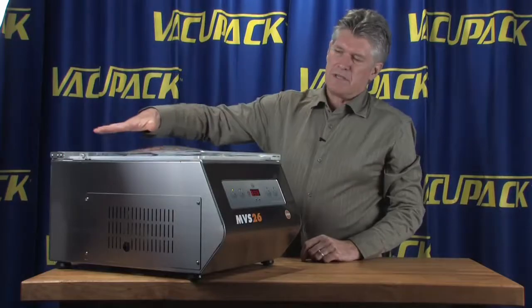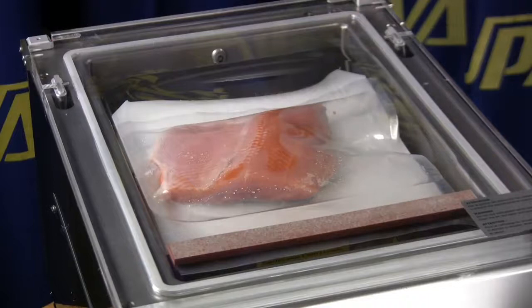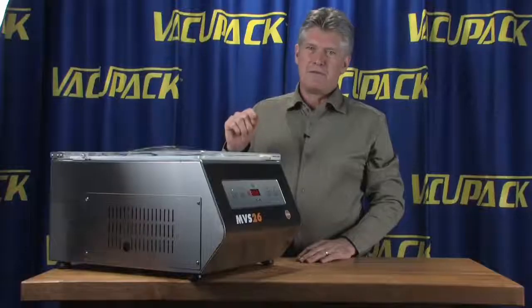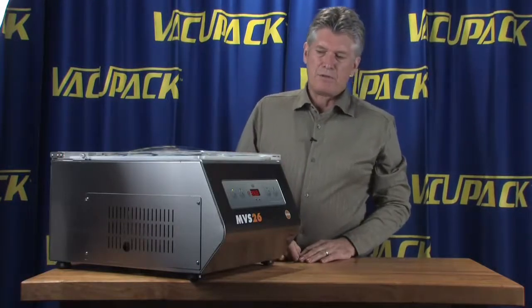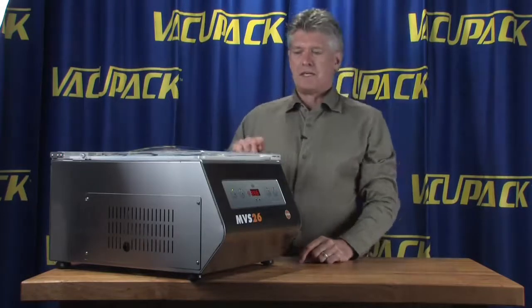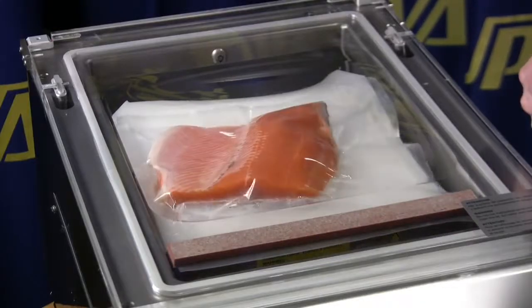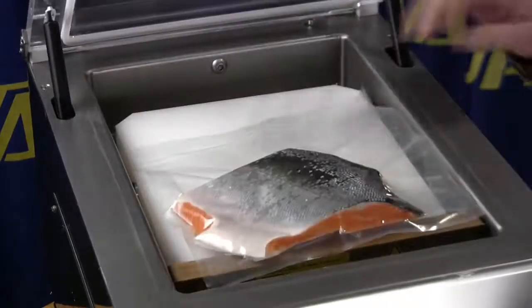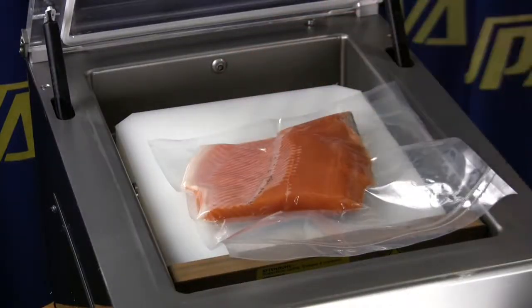The object of the game here is to let the pump run and have the bag sitting inside the chamber and flat across the heat seal bar so the air can be extracted from the bag without running an extended cycle or working your pump too hard. When we get up to 99.9% of the air, the heat cycle is going to come on and that will jump the heat bar up against the top of the lid. The air gets let back into the chamber. The MVS26 does have a little bit slower DVAC on it, which actually lays the plastic down on your food a little bit slower.